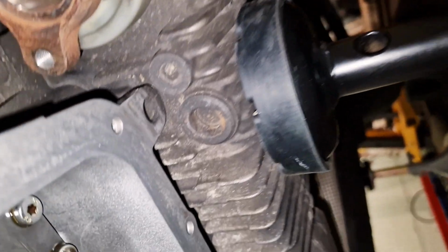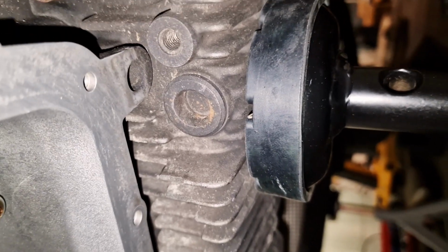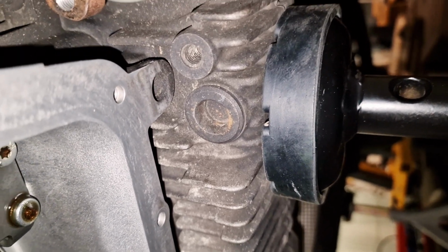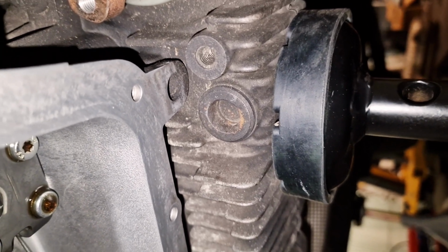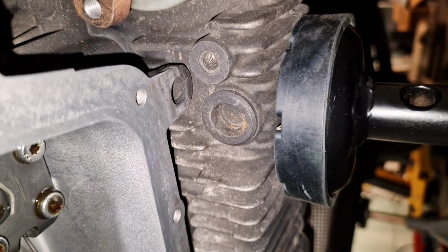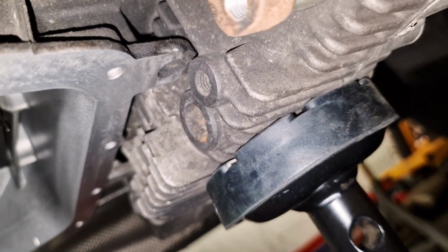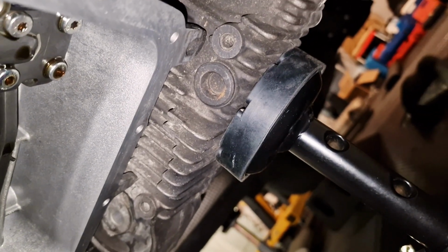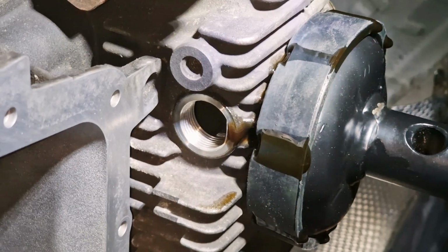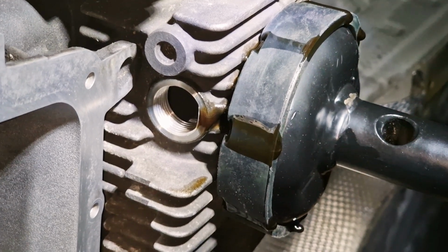And what I noticed, this is the drain plug for the transfer case, and since I'm going to change the fluid in the transfer case as well, and some additional work I'm going to perform here related to flanges, I'm going to drain it now, just because see the distance here to the oil sump. So now I have perfect access, and it's time to drain the oil from here, I guess. Okay, so it doesn't look very beautiful just because see my jack stand, but anyway, at least now I have a lot of space.